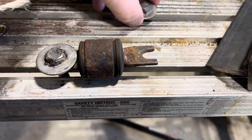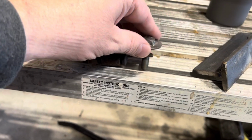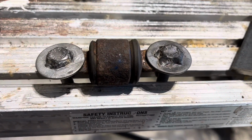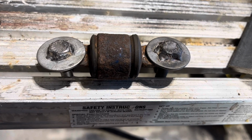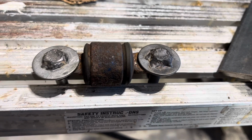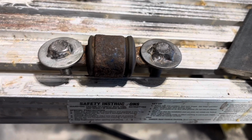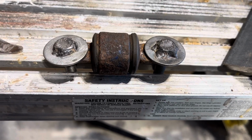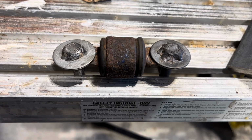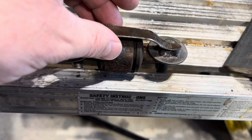and tacked them to the washers there. So, all right, those will drop down through the hole. My next problem is now they're going to spin unless I either tack them up in there or find a way to fasten them together so they don't spin. So I took a scrap piece of exhaust I had and cut it and flattened it out and then bent it until I got kind of a piece I wanted.